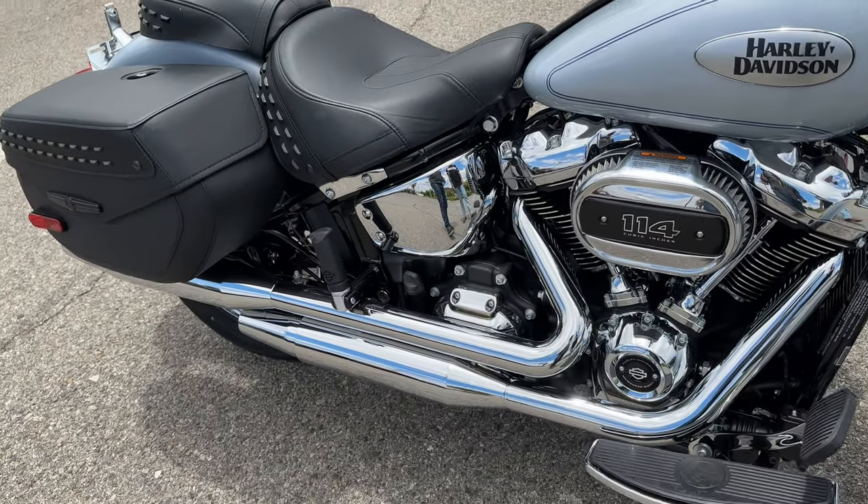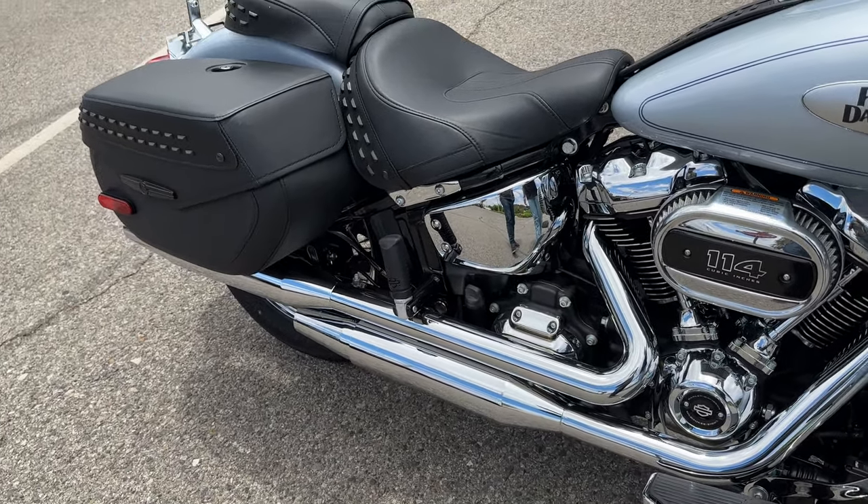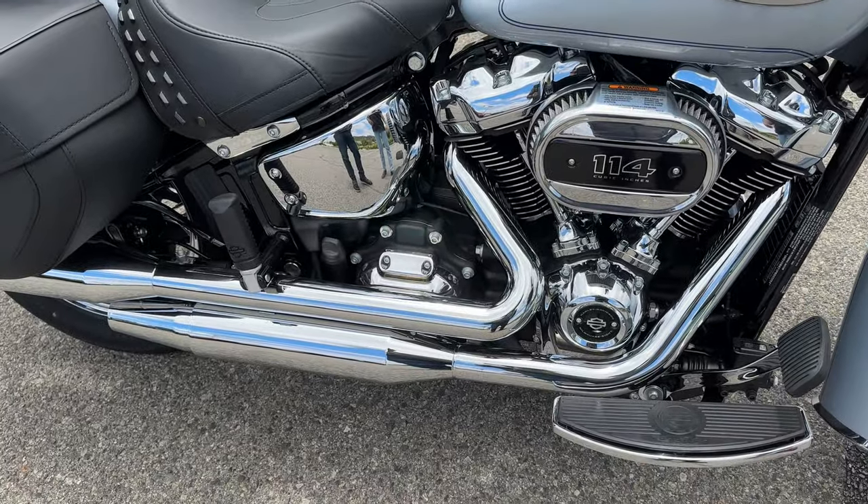For newer folks to Harley, this is a Softail, carrying on a long tradition. In the case of a modern Softail, that means a monoshock in the rear that's hidden. Back in the old days — starting around 1984 — the Softail was invented with two smaller hidden shocks. With the new design, you have that floating swing arm. The old-style shocks were actually laying parallel and flat to the ground, horizontal at the bottom of the bike.